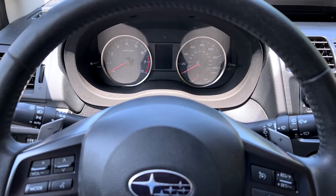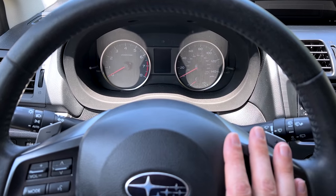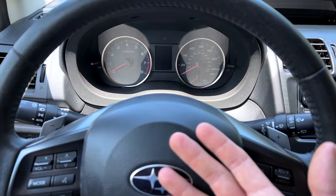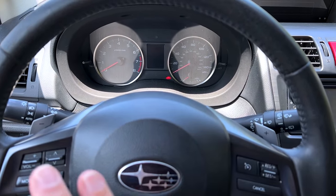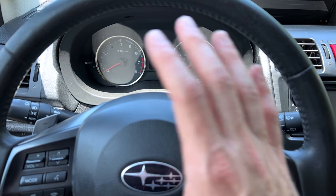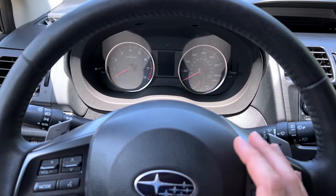What that is, is you can crank your engine over while disabling your spark and your fuel to build oil pressure primarily. I like to do this anytime I've done a head gasket replacement or done an engine reseal where I've completely drained the oil out, done an oil pump replacement, oil pump reseal, resealed the oil pan, done head gaskets — anything like that. I like to do a clear flood mode crank just to build oil pressure up in the engine, circulate oil through the engine, get that pressurized oil into the cylinder head, lubricate all of the components of the cylinder head and the valve train, get it flowing through the system, and get the system primed up before starting the engine.